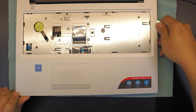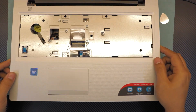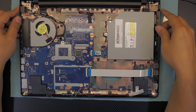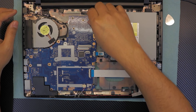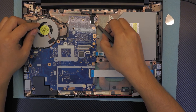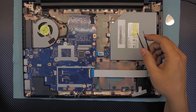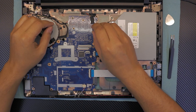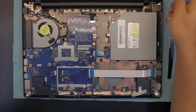Go all around it, then grab the front side, wiggle it around, and it will come out. Now the first thing before anything else, you want to unhook the battery cable. Don't do it with metal tweezers — you don't want to short the battery. Use plastic tweezers or your fingernails, or any kind of plastic tool. Lift up the tape carefully.